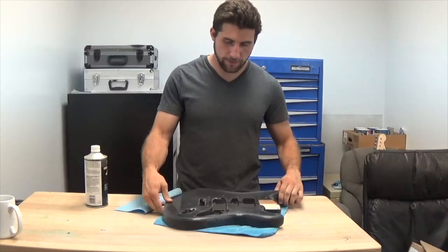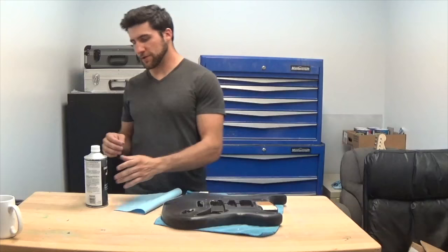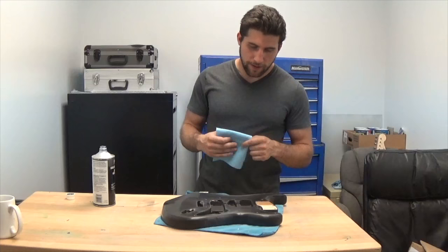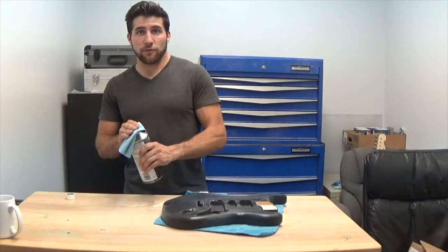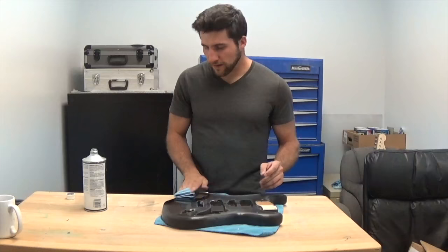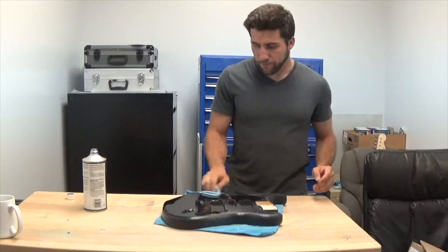It is a little dirty though because I just spent time sanding it, so next we have to clean it. What I have here is wax and grease remover — you need something that will act as a degreaser before you paint. Another thing that acts as a degreaser: naphtha works, lighter fluid works fine, Windex works fine, so you don't need to go to an automotive shop. Don't use a heavy solvent though.